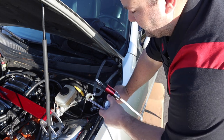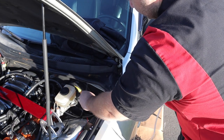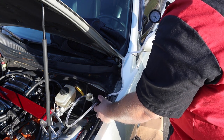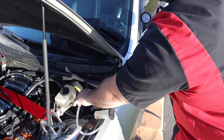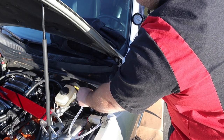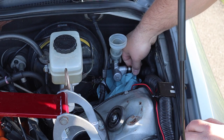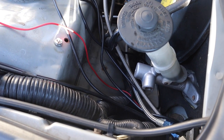To try not to make a mess, I'm going to use my brake bleeder to suck out the fluid from the reservoir. This is even better than a turkey baster. I've always wondered what the little black float is in these Toyota master cylinders — if anyone in the comments can tell me, I'd greatly appreciate it. Now that we've got the float out, we'll disconnect the line. This goes to the XAT Racing throwout bearing. Now that we have the clutch line removed from the master cylinder and it's drained of fluid, we can remove it from the car.